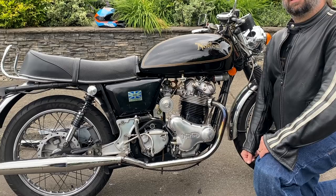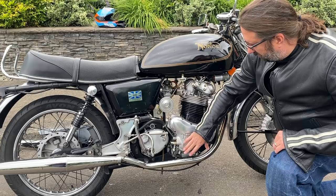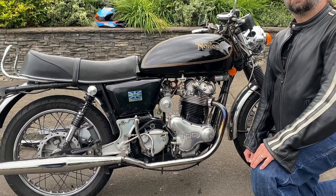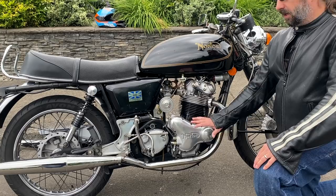This is probably a stupid question, but how do you know when you pull that pin that it relocates? Because there's nowhere else for it to go - there is nowhere else to go. That pin actually goes into this hole here, and once the cover and oil pump are installed, that pin's just sitting here and you just give it a yank and that just lets the ball fall right up against the oil pump. They do pretty comprehensive mods as well, especially as they take the oil pump apart and add those seals.